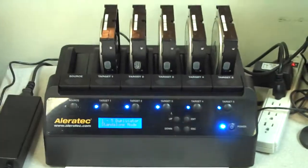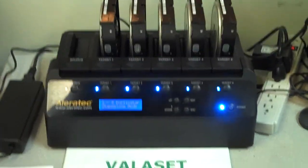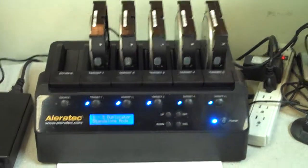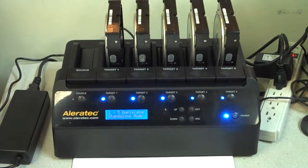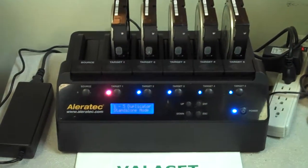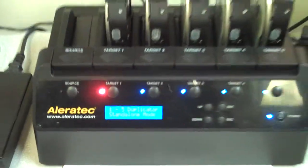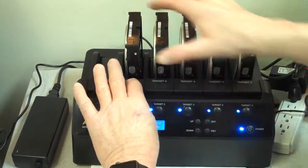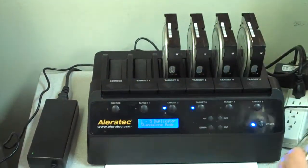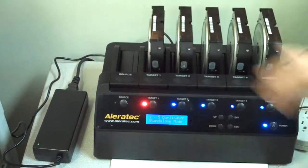It's powered up now and we're getting a blue light with each of the five drives. If it boots up and you see a red light come on one of these drives, that would indicate right away that you've got a drive with a problem. And now that it's gone through its boot procedure, you can see the first drive in slot one is indicating a red light, which means we've got a bad drive. So I'm going to have my tech go ahead and remove that drive and plug in another one to see if we've got a functioning drive.